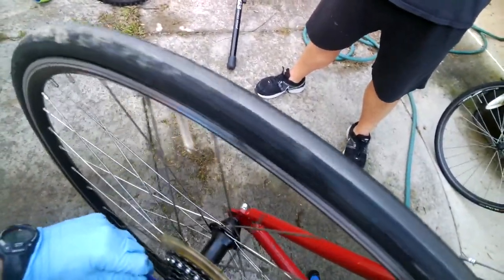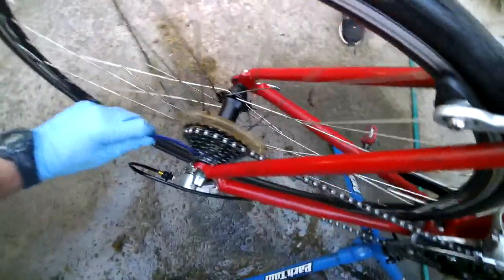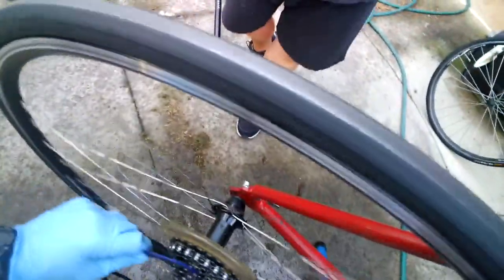Yeah. Now see, look, there's actually... This is so bad that I'm going to use these teeth on it. I rarely, if ever, use them unless I'm doing cyclocross. So I'm running the teeth through here so I can actually get the grease down out of the cogs, because it's stuck in the cogs.